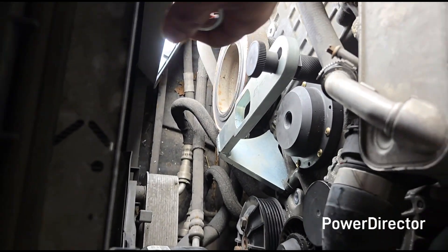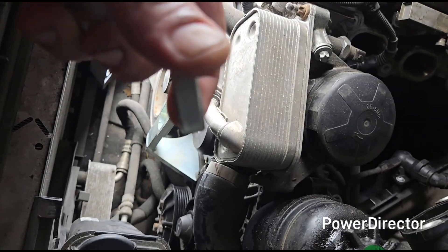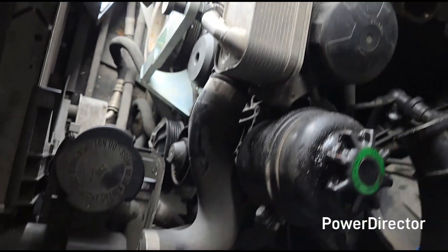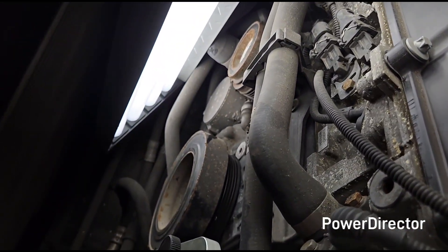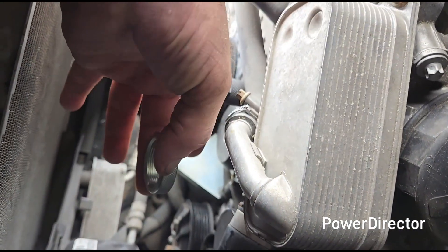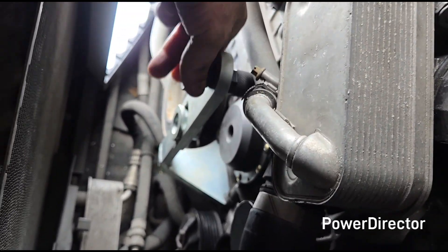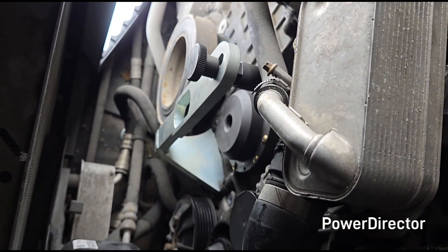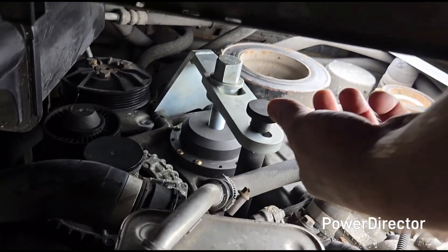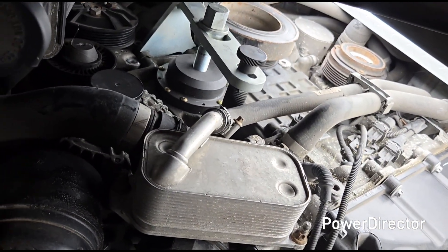In the center of the bracket was this piece, oriented with the big collar facing up — but the puller wouldn't fit, so I had to reverse it. This piece with the threads on it has to go on the front right here. Otherwise the bolt isn't long enough to catch back there with the other piece on. You'll need to orient it so this piece is on this side. When lining it up, loosen things up, get the threads started, and then tighten everything back down — if not you're going to cross-thread it. I almost did that. Now the puller is set up, everything's tightened and centered, and we are ready to start pulling this thing out.